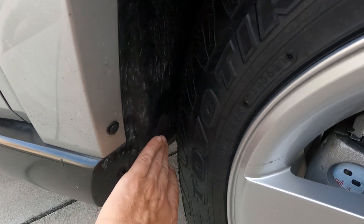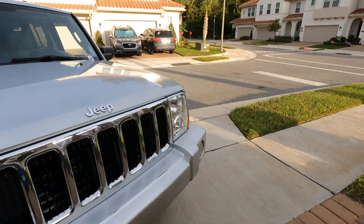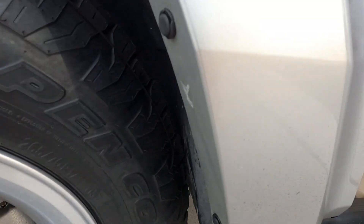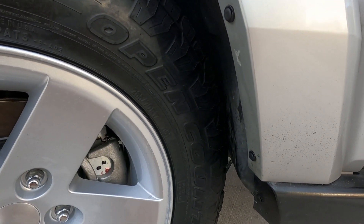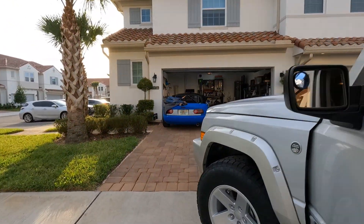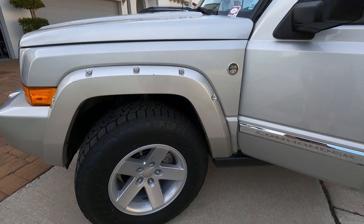Let's see how we did on the other side — that's the real side we need to figure out. I'm going to go ahead and turn the wheel. Still looks like we're touching a little bit, but it's not nearly as bad as it was. I'd say it's only touching at full lock. Let me straighten the wheel out a little bit — we're at full lock right now. This is more of a normal steering position... yeah, we've got all the clearance in the world there. I rarely ever go full lock, so I would call that a mild success.